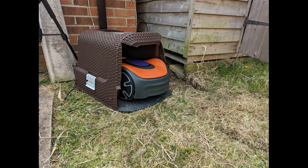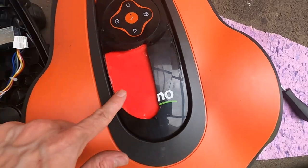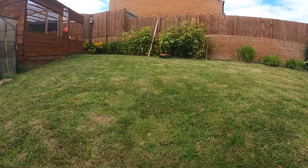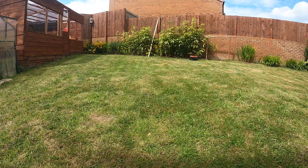I've put the base down in a corner of the garden and run the boundary wires using the satellite cable, which works great. You just put a spade connector on the end and bury it about an inch around the outside of the garden. I also made a little plastic cover, glued it in place to cover the damaged part on the top, then put another cover over it to make it more watertight. Sending it off for its first run, you can see it tracing around the edge of the boundary wire quite successfully.